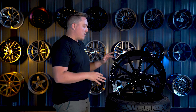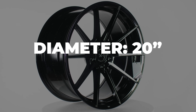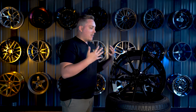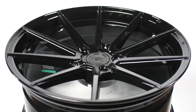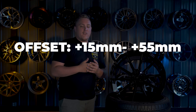One thing to note about Variant wheels is that they are pretty big. The Argon is currently offered in a 20-inch diameter with widths ranging from 9 up to 11 inches, which is thanks to the manufacturing process that allows for wider widths with larger diameters. When you get into the wider widths, the face starts to fall back due to the lower offsets these are offered in, giving a nice bit of concavity. With offsets ranging from plus 15 up to plus 55, you can see these in a bunch of different variations.